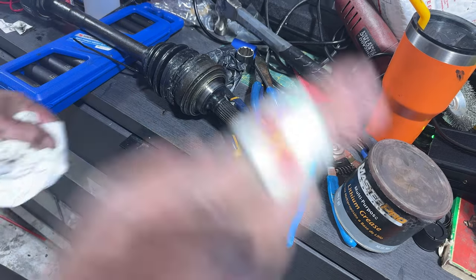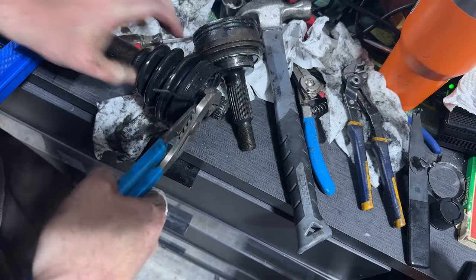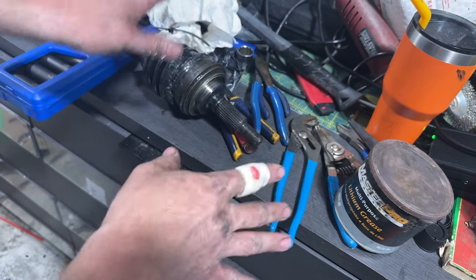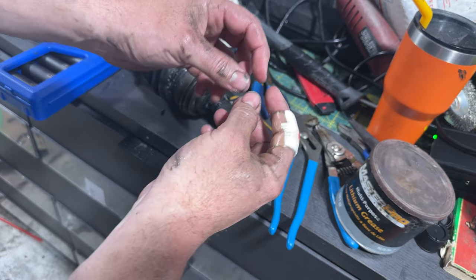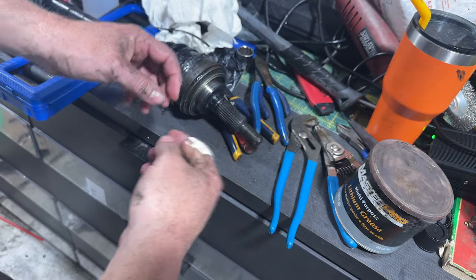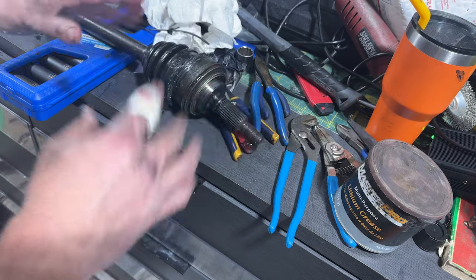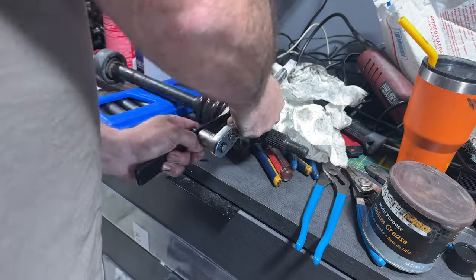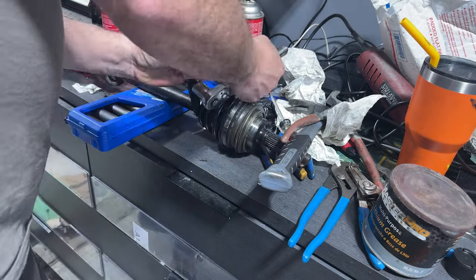You're not going to ask me how it happened and we're just going to deal with the fact that this is on here now. In reality, I broke several zip ties trying to do a zip tie trick where you zip tie it around the little C clip and then push everything down over top - it's supposed to act as a spring compressor, and it didn't work four times. So I just took the clip off again, squeezed it real tight, put it back on squeezed it again as much as I could, then put my finger in there while pushing this on real gentle, worked the clip in, tapped it a little with the hammer, felt around and the clip was not exposed, tapped a little more, and sure enough it just sunk right down onto the shaft. We are home. Now it's time to put actual clamps on this thing using the tool Kel let me borrow and the clamps that came with the boot, banding the two ends of the CV boot.